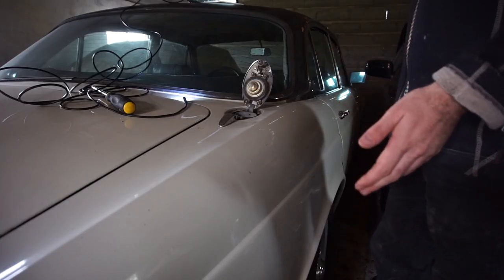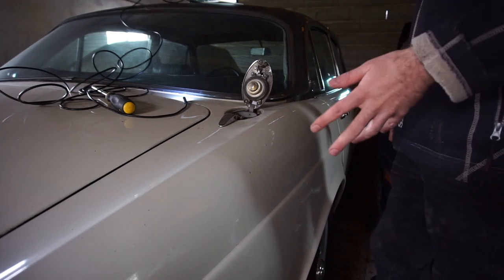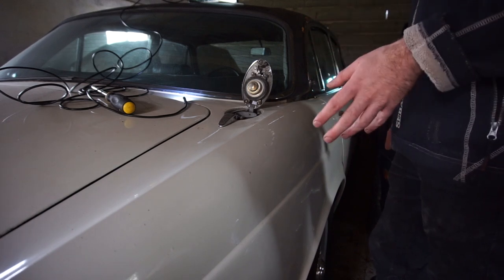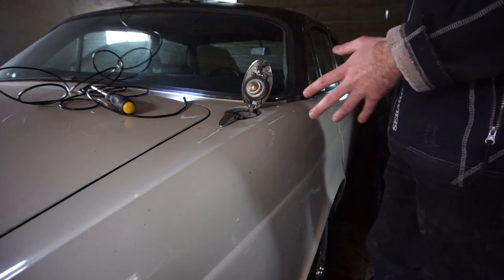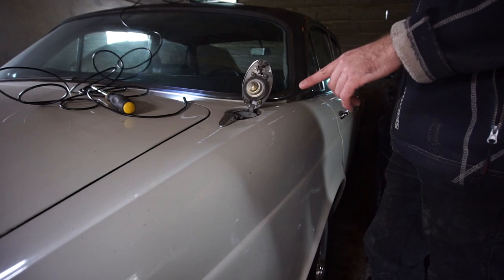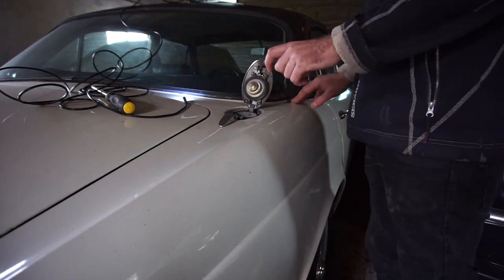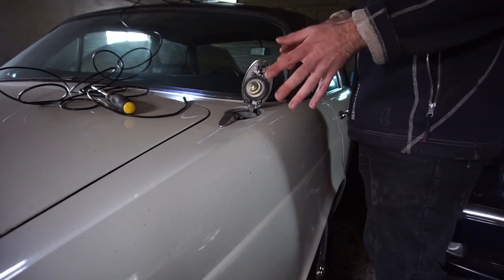We've switched cars and locations. This is my 1977 XJ12. About a month or so ago I sort of woke this thing up again — gave it a service, had a look inside the fuel filters, which were very nice and clean inside even though they'd been on there for about five years, no rust or debris. My plan was just to go for a drive, fill up with gas, and hopefully get it inspected. However, as soon as I put some gas from a jerry can in, I noticed a fuel leak down below. We traced that in a later video to one of the fuel lines being completely perished. I've gotten all new lines to replace, but I thought while I'm at it let's have a look inside the tank.